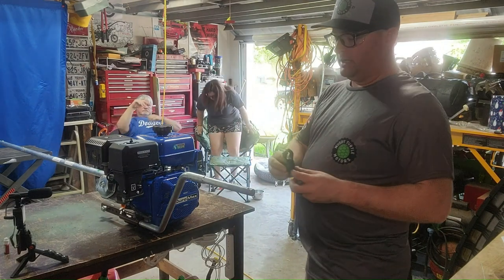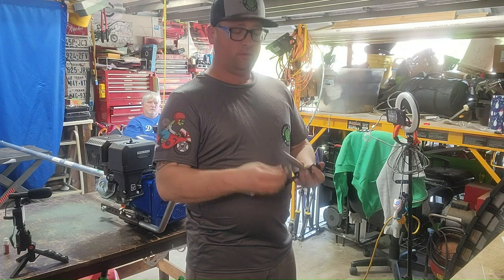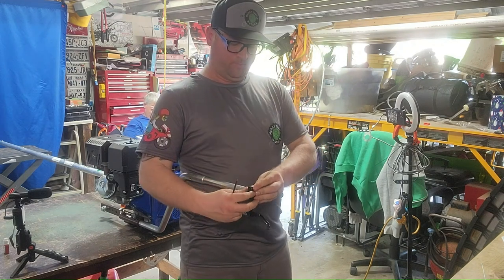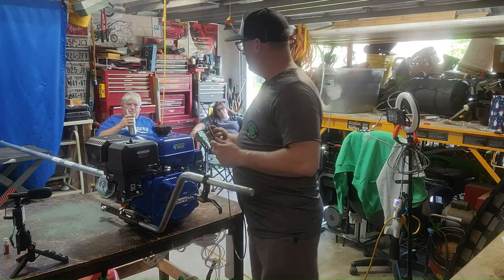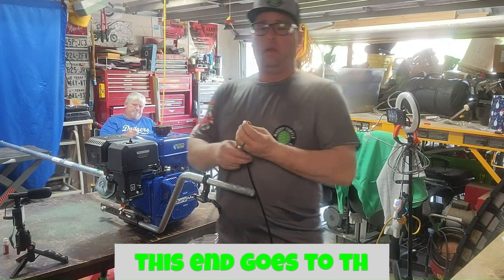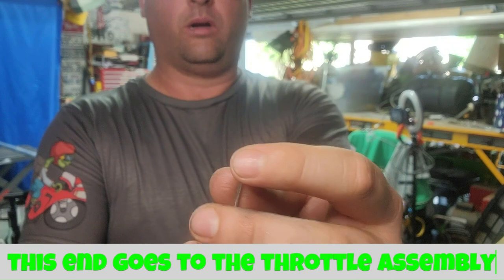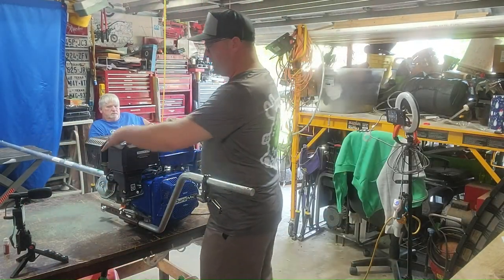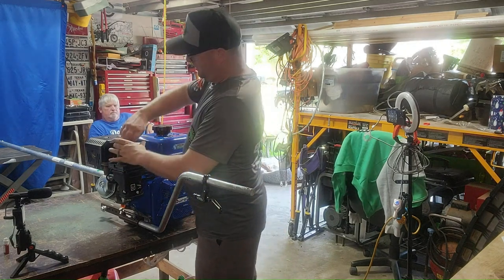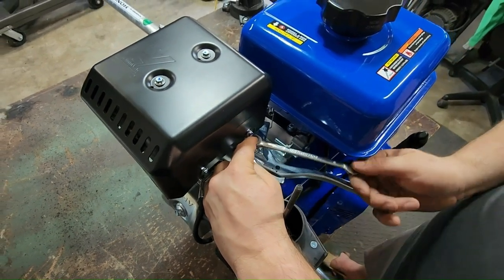Now we're going to be setting up our throttle. We're going to start by placing our throttle cable — I want the grip right here, nice and tight to my body. I'm going to use my 4mm P-handle. You want the cable side going back towards the motor. When you're hooking this up, make sure you use the drum end — that's the end with the knob — that goes to your actual throttle. The narrow end goes into the carburetor, onto the throttle control arm. To get to the throttle control arm, we're going to take off the air box. There's a wing nut on top — air box comes off. There's going to be another wing nut on the filter. Now I'm removing the throttle control arm so I can take off the friction washer underneath it.